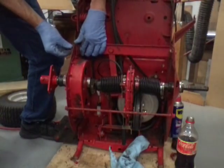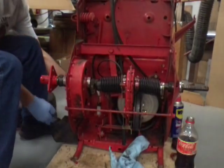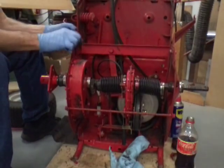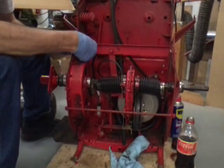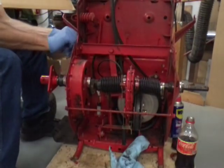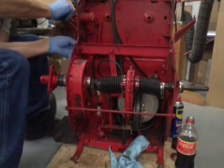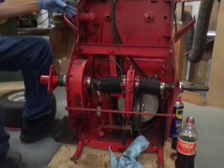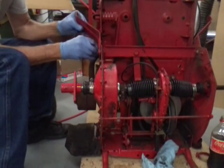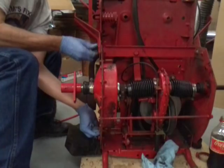Get my linkage in there. Now the nut and bolt go on — nut goes on the inside — and the other self-tapping bolt they use on these things goes in the top. You want to make sure you get them started straight, otherwise they will cut new threads and that won't do you much good — it'll make the threads strip out faster if every time you put these in they want to cut new threads.